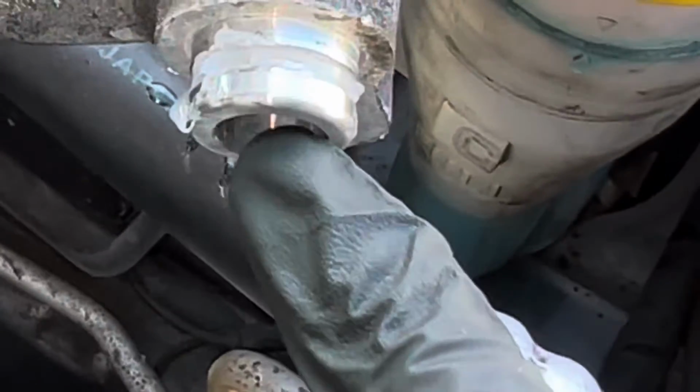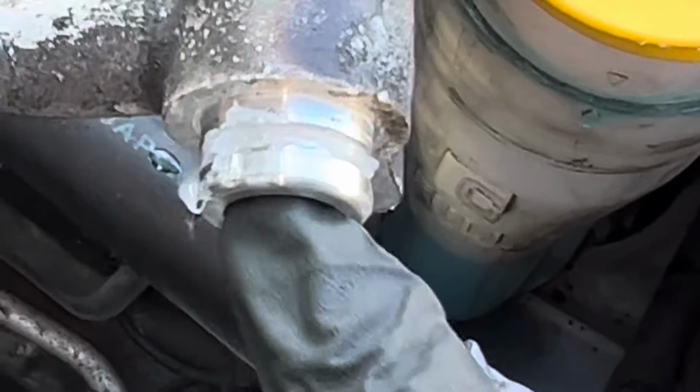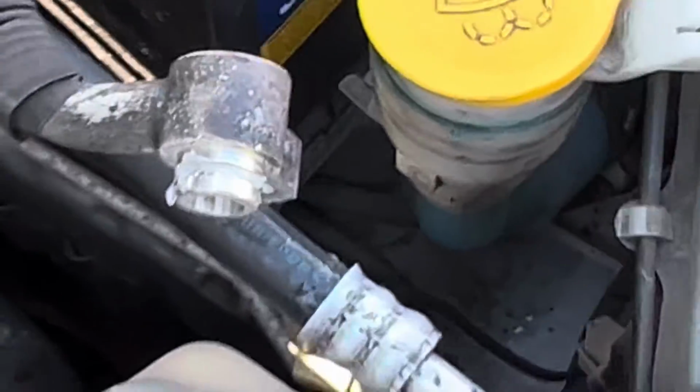Focus. Inside the groove. Nothing is going to get up here because you're going to put your lubricant in the groove. You're going to smear it backwards. You're not going to get anything in the path of refrigerant. It all goes outside, never exposed to the refrigerant.